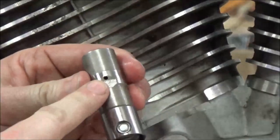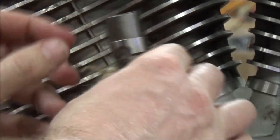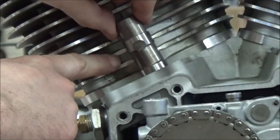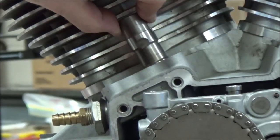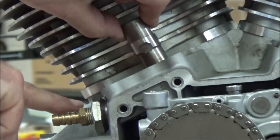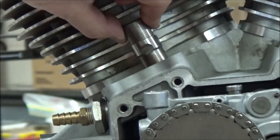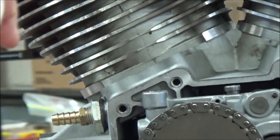The whole idea of positioning the oil hole is that we want it facing inboard, per the service manual. The oil gets fed through the back of the case in this direction — you'll remember from disassembly — and having the hole inboard means it fills that lifter as fast as possible.